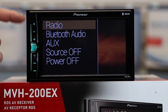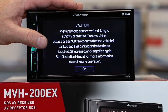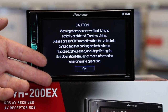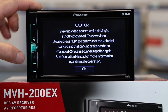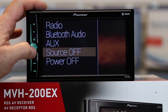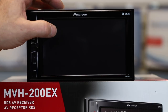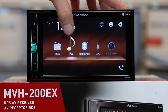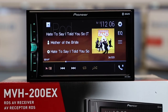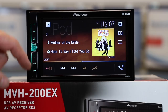If you hit the home button or the drop-down arrow, this will also list your sources. Next up is the auxiliary — this has a true AV input, a full AV input, so you can hook up the CA-C3AV aux cable to connect an iSimple Media Links HDMI to mirror your phone, and this unit is totally compatible with that. Source Off will put the unit to sleep and still allow you to make and receive Bluetooth phone calls. Power Off is just like pressing and holding the menu button — it turns the radio off. Next up is the USB. You can hook up an iPod, an Android using MTP, or a thumb drive encoded in FAT32 or 16. It will display album artwork when connected over USB, and you can track up, track down, or search through your artist, albums, and playlists.